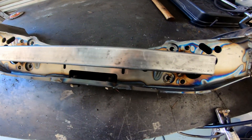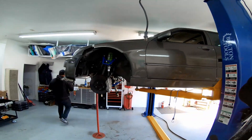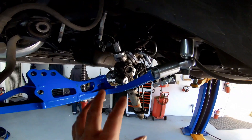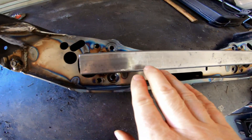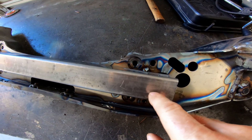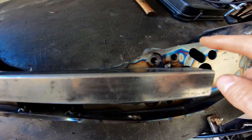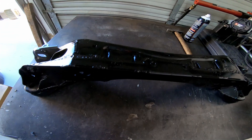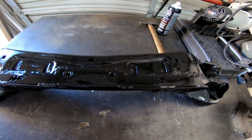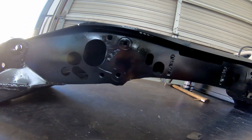I wrapped up welding without removing the steering rack since the hydraulic lines were still hooked up. Instead, I took a 1.5" by 1.5" square piece of tubing and tacked it in place right next to where the rack bolts up, keeping the insert square even while it gets very hot during welding around the perimeter of the plate. Here's what the subframe looks like after the insert is fully welded in. We threw some paint on it — it's still a little sticky, but we're going to let it dry and then install it and button everything up.